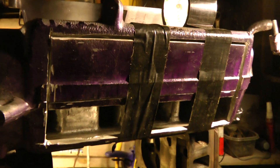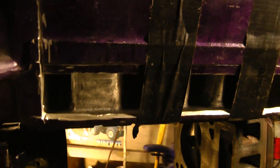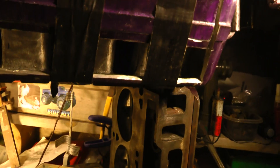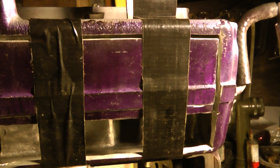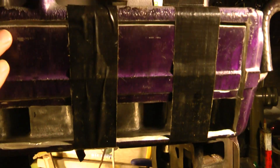If you've taken the truck manifold far enough to where you're going to cut it open and open up these ports for cross-sectional area, you'll probably realize the way that you have to cut this into pieces. And depending on the thickness of your cut-off wheel, you'll realize: how do I stick this back together? And wonder, well, how am I going to weld that back?